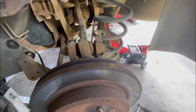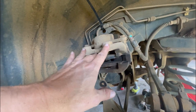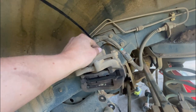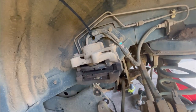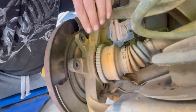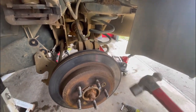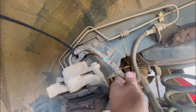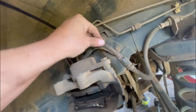I also forgot to mention you need to get the brake calipers off, which is pretty easy. You've got two options — you can take the whole bracket out, which is just two 15mm bolts, or you can take the caliper off the bracket, which is also two 15mm bolts. I've just taken the whole thing off. You've got the 15mm out anyway for doing these arms so it's just the two bolts — really straightforward. They might be a bit tight but just get a little hammer and give them a tap. Just tie it up out of the way and try not to put too much tension on the rubber hoses because, especially being old, they can get brittle and start to crack and perish.